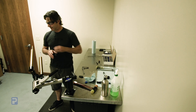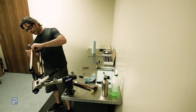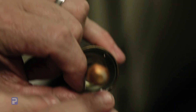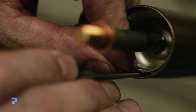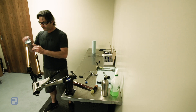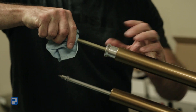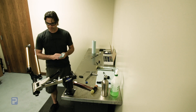Now using our dental pick, we're going to find the retaining ring at the bottom of the fork leg. We're going to find the section that's got the little flap that's up so we can get underneath it, and then just pry it up and around — it'll come right out. We're going to be reusing that, so set that aside. Now we're just going to wiggle and pull the air shaft assembly out; usually they have a bunch of goop on them. Set that aside because we're not going to be using it.